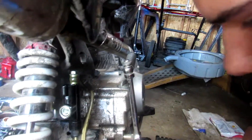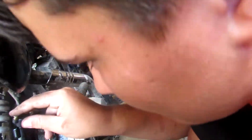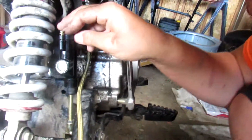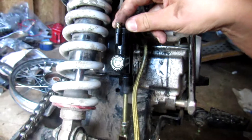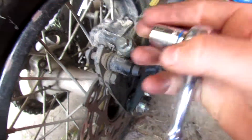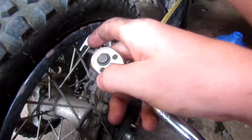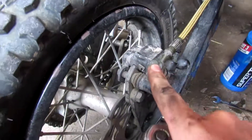That's about good, but we're gonna have to bleed the brakes so we'll need to put more in anyway. Now our brake line is in the way of the bleeder screw, so you gotta find a socket to loosen that up — I believe it's a 10 — so let's get a 10.